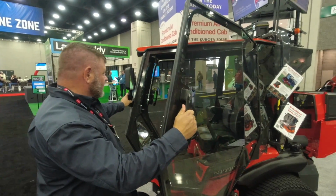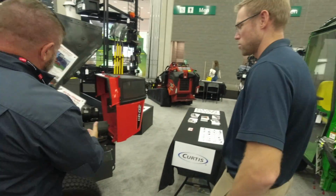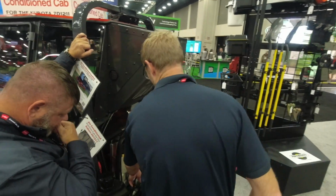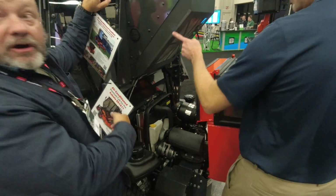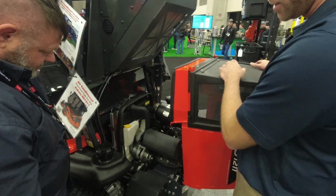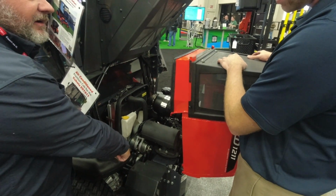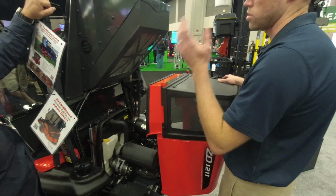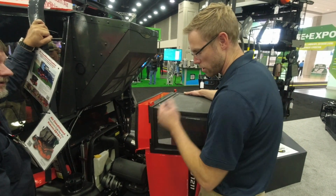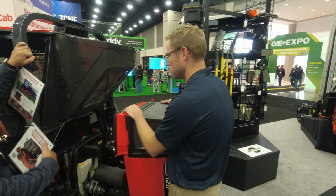No, it runs belt driven off the engine, so the compressor is belt driven. So why does it have two clutches? Those actually aren't clutches. Those are the dynamos that generate the electrical power for the vehicle. So they're kind of an alternator. I think I said the word dynamo. So you're kind of right on the alternator thing too. So the pumps always turn. Is there a clutch down there? No, there's a clutch on the compressor. It's just like a car. I'm a gearhead. It's an automotive compressor. Nothing special. All automotive components, so that's all proven. You don't have to reinvent the wheel. Nope.